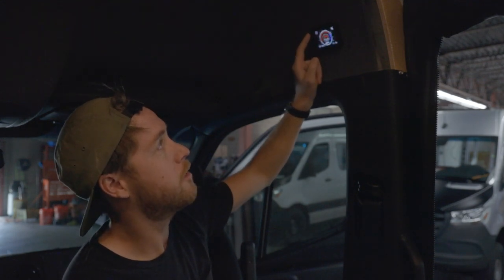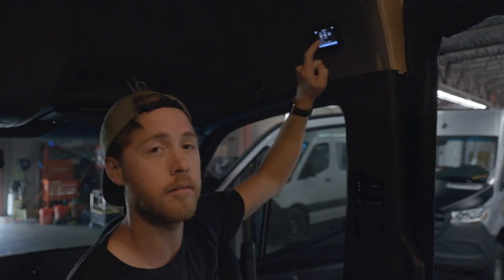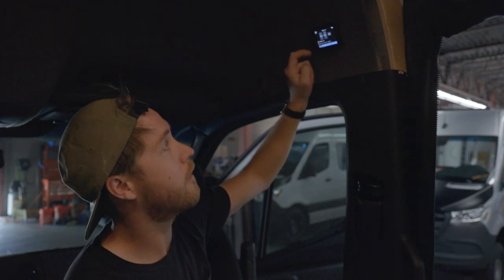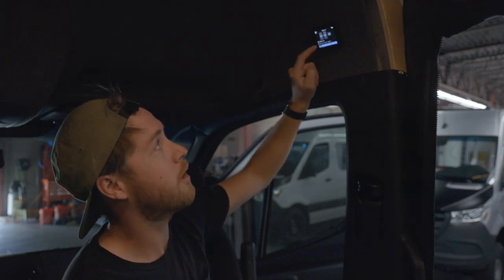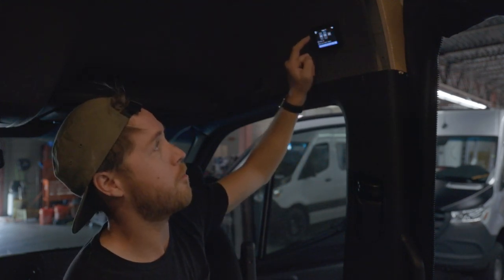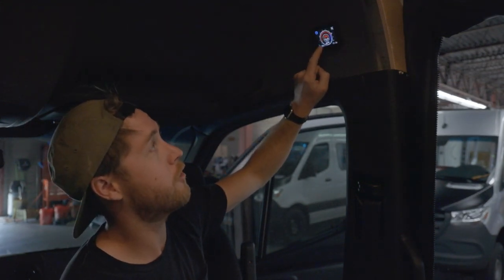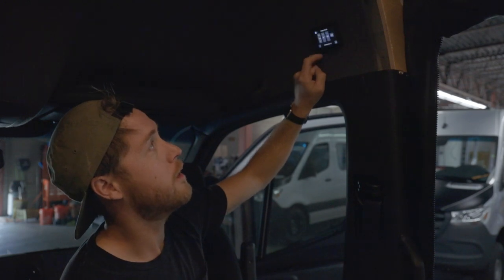The exit button is in the top left. The timer setting is also handy — you can set various timers for the heater to run automatically. Say you get up for work at 8 a.m. every morning and want the van preheated — you can set that per day of the week. You can set three timers per day for seven days a week. To change the time, just hold the time icon to set your date and time — important if you're running those timers.